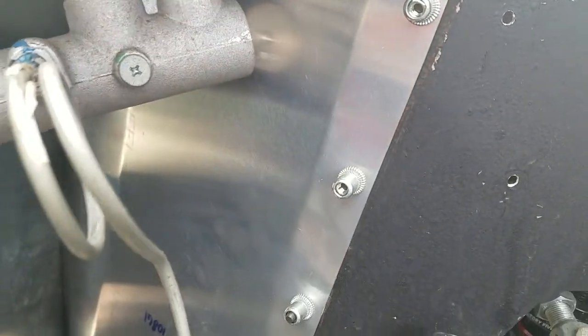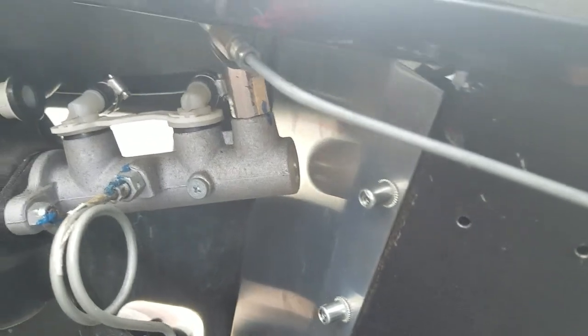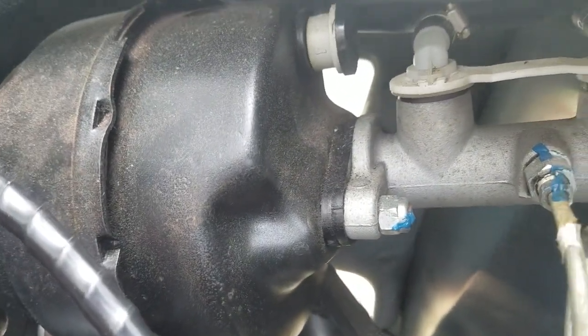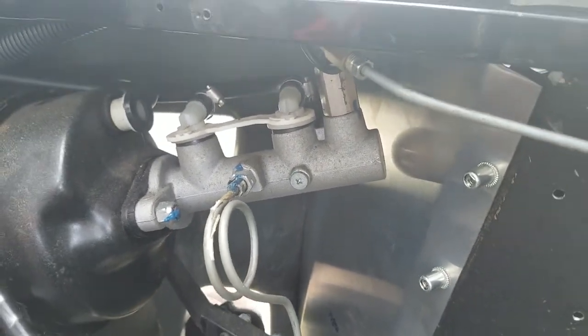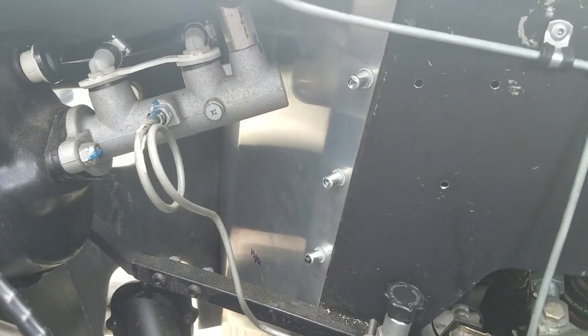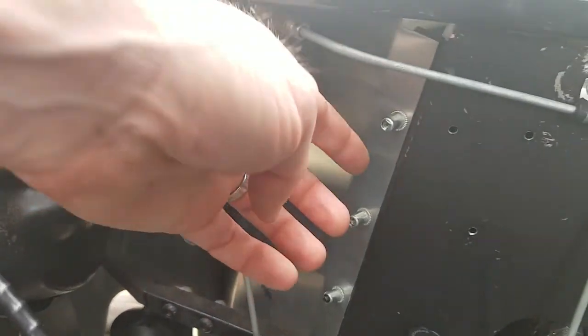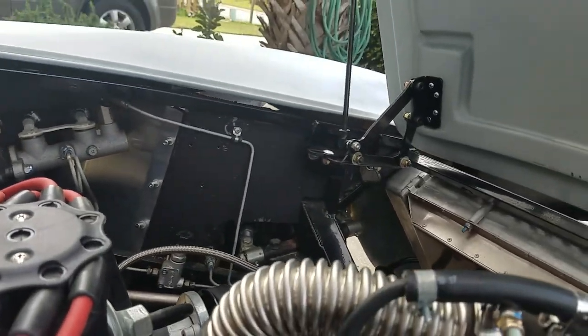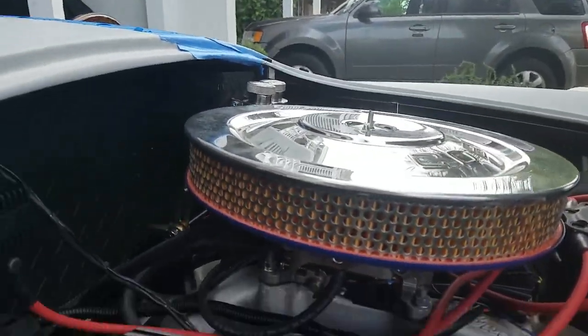Here's the backsplash — they call it the elephant ear. I have a gap there that I'll need to address; I may have to make a small notch because the studs are in the booster. The riv nuts allow me to take the elephant ears on and off. I found it better on one side to put the flange behind the firewall panel. I also need to cut a two- or three-inch hole to run the heater hose through into the fan.